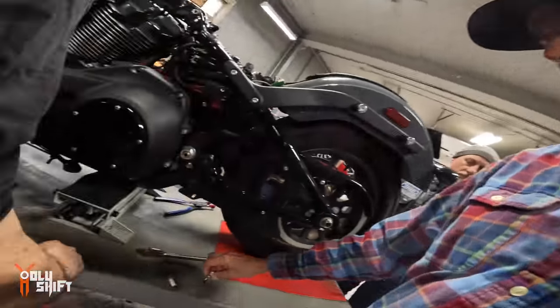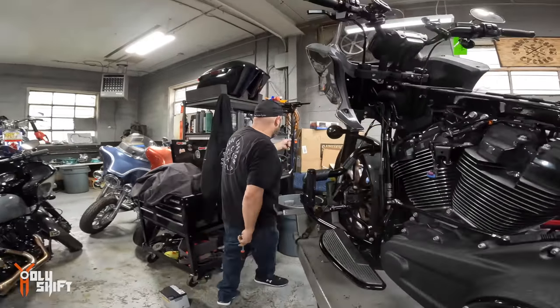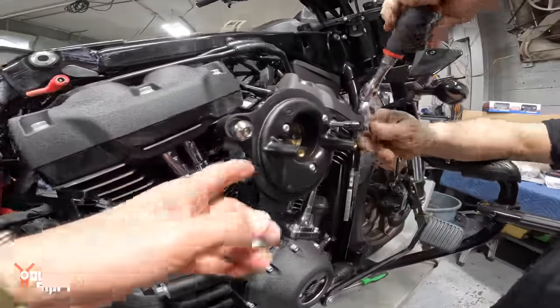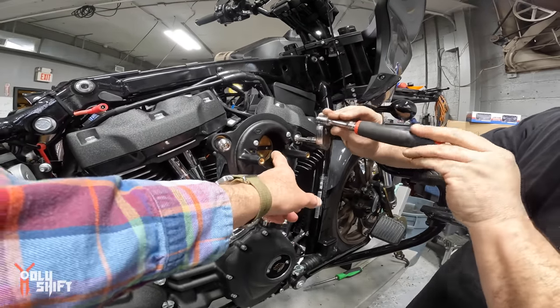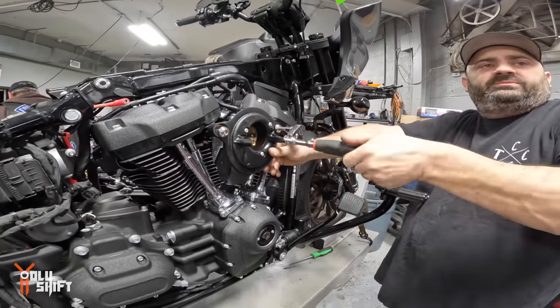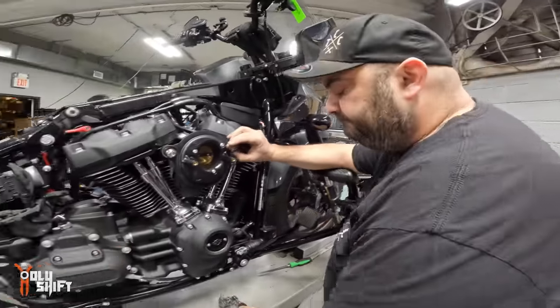Then when we do the full dyno, I was gonna do not a delete kit but an external drain. I would probably do a vented dipstick. Vented? No, but for the blow-by, I don't want the blow-by. Yeah, but that'll decrease it. It's a whole oiling system, and putting the vented dipstick in will help with that. Yeah, I'll do that.